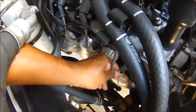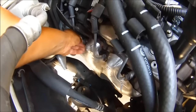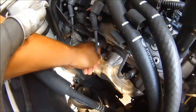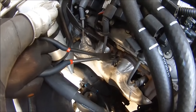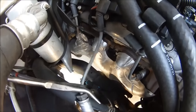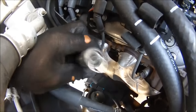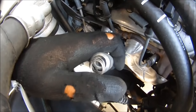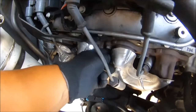This one's kind of loose. This one's not loose. These aren't that loose, but this one is. This one's barely — okay, just pull the spark plug boot out. See how it looks down there. Looks like that was on right. Let's check the spark plug, see if it's loose. We got a loose spark plug, big time.